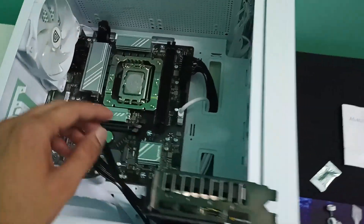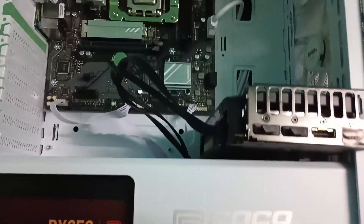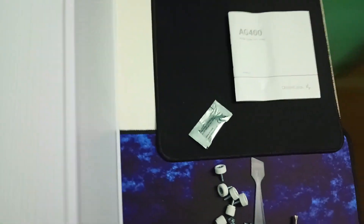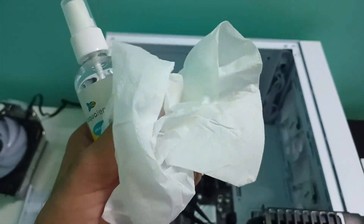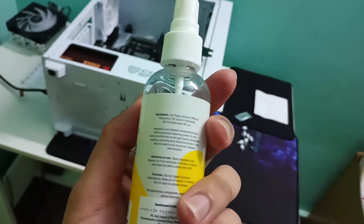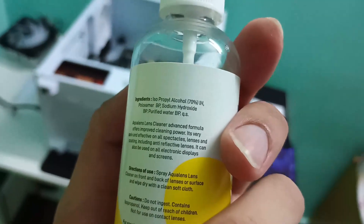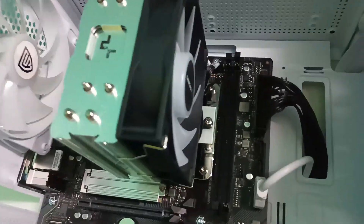We have to clean the thermal paste and apply a new one. I can't show the full process because I'm holding the camera in one hand and working with the other. We'll use the 70% alcohol eye lens cleaner for cleaning the CPU — after cleaning it looks good enough, and the stock cooler base has also been cleaned. I would still suggest 90% alcohol. Now we apply the new thermal paste on the CPU and at the base of the air cooler, and the critical step of applying the paste and fixing the air cooler is finished.